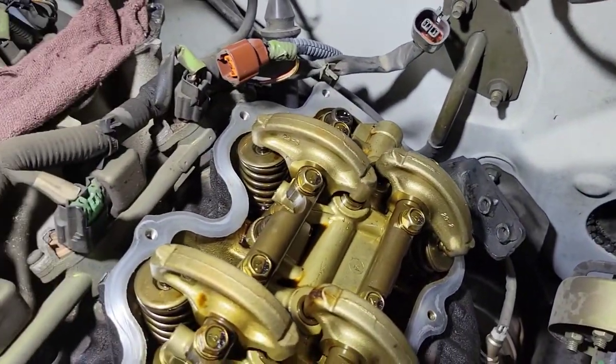I hope you enjoyed that video and if you've never done this before I hope it helps you feel comfortable doing this job. Watching this will also help you avoid taking apart things you don't have to. The first time I did one of these, I flipped the plenum over, tried to remove pipes, took off the throttle body, took off the EGR valve — all unnecessary work. These engines are super common for everything to break, so the more stuff you take off the more problems you create. Every time I touched these early on I'd end up with a coolant leak to fix.